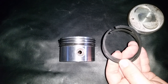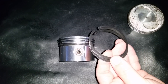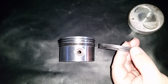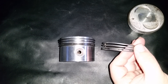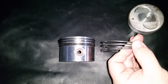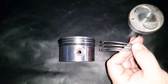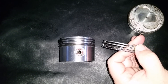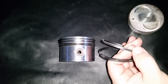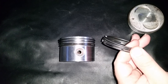This is the color the piston rings were originally — just like this new set here. As you put run time on them you can see the wear lines and the break-in process start to show. This set has quite a bit more time than the Subaru piston, which is how I can confirm that the Subaru is in fact low hours, just like the seller told me.